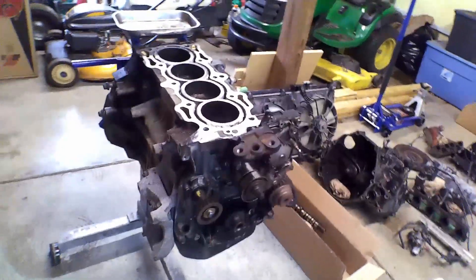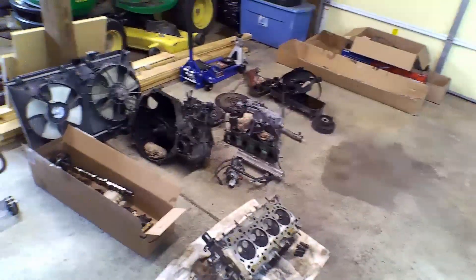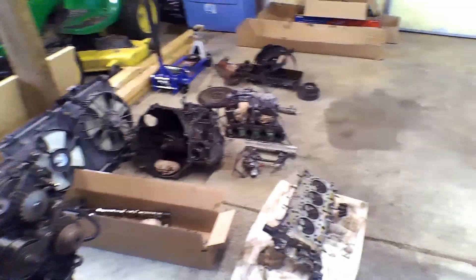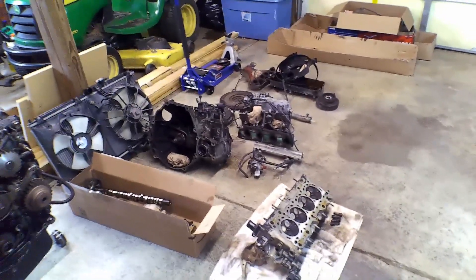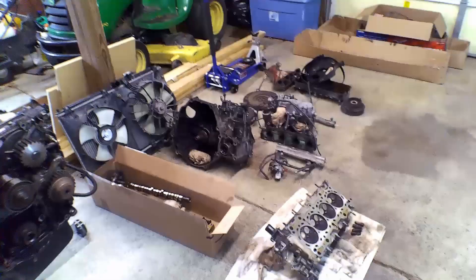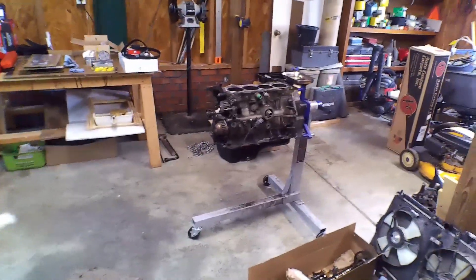After I decided to park the car, I found out that a blown head gasket and an engine using a lot of water could damage the catalytic converter. I didn't want to go that route trying to find one in a junkyard, so I parked the car. It sat for a month to a month and a half, and when I went to move it, it wouldn't crank the first time — it had always started right up before. When it was turning over you heard that 'wah wah wah' sound, so I knew we were down on compression in at least one cylinder, even though the car had always run fine with no noticeable power problem.